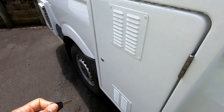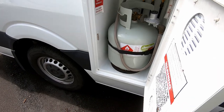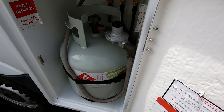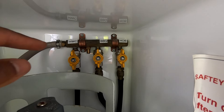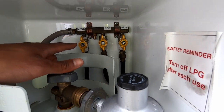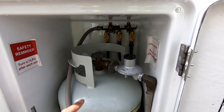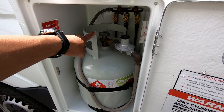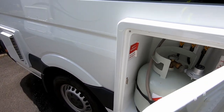Next, coming over to the gas bottle — you're going to use this gold key. Turn it like so and you can open the gas bottle. You'll need this for your gas hob, your barbecue, and your hot water cylinder. Over here we've also got shut-off valves if you need them. These can stay in the open position, but if you're hibernating the vehicle you can close them off — they're also there in an emergency. Always remember to turn off the gas bottle before driving or moving campsites.